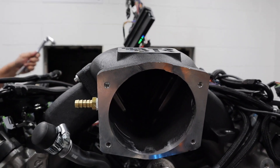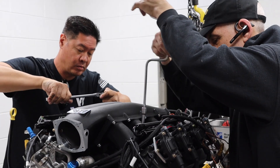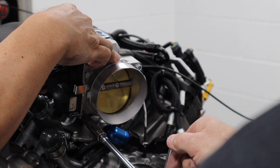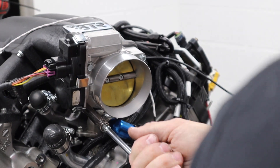If you're doing a naturally aspirated engine, this is going to want to peak in the 6,600 to 7,400–7,500 RPM range, depending on the camshaft, cylinder heads, and compression ratio you're running. On the other hand, if you have a boosted application, that tuning length becomes much, much less significant. On many of the Radial vs. the World cars, Pro 275s, X275s — all those boosted cars — you have pretty short runners, because you don't need that Helmholtz resonator effect all the way back to atmosphere.